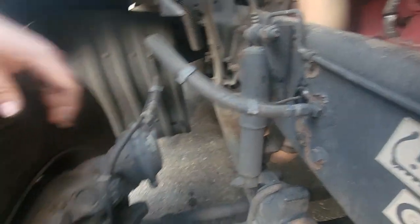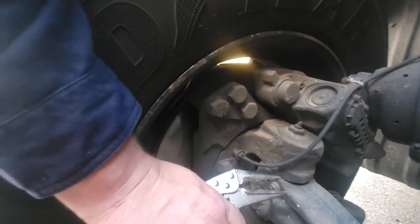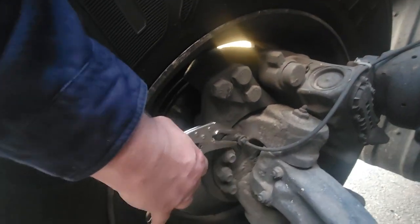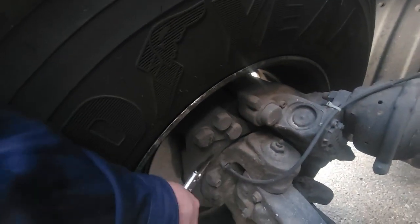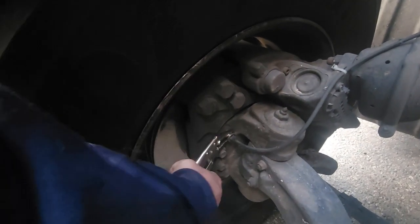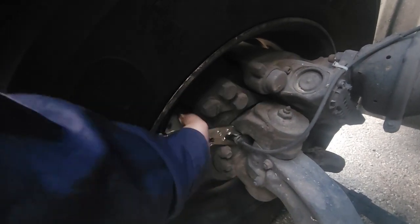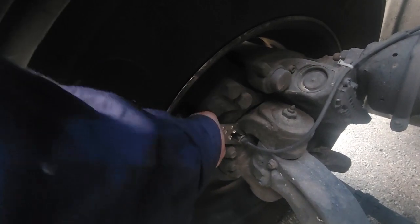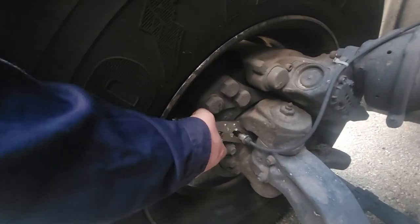Alright, let's go down to the sensor. Fold the wire down to the sensor — there's a little middle piece sticking out where the long pliers come in handy, because you can go past the sensor onto the wheel assembly itself. That gives you leverage to pull it out — you just go in front of the metal part and pry. As you get it out further and further you can get down on the wheel assembly and get really good leverage, because it's pretty long, not a short piece.